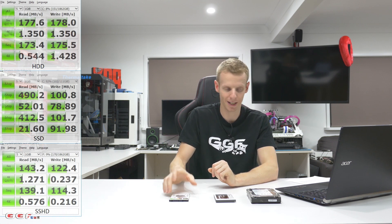Whereas the two hard drives are around 1.2MB/s for random writes. Most standard hard drives reviewed around the net will be around the 1s and 2s, so that's expected. For sequential write, the mechanical hard drive was 178MB/s — very nice. The SSD surprisingly dropped down to 100MB/s write; I'm not sure why that was so low as the Fury should be better than that. And the SSHD write was 122MB/s. That covers the raw synthetic test results.